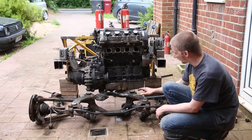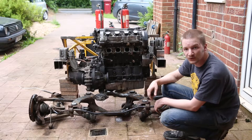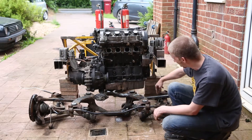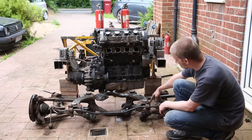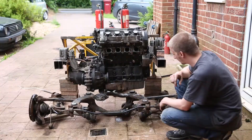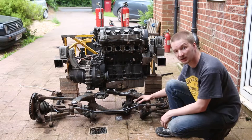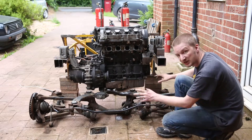So this is roughly how we think it's going to line up. We've just got it all sitting a bit lower down than it really should be because we've got an engine in the way. We think we're going to have to shorten our upper arms, and rather than have the pivot point inboard inside our sump, put it somewhat further out so we've got like a sort of 8 to 10 inch upper arm. The lower arm we can probably keep just about under the sump. The entire subframe, including the whole diff mount, is a total waste to us because we can't really move it or modify it. Because we're going to be using custom suspension hookups, this can go — but for now it's kind of easy to locate everything else, so we're keeping it for the time being.